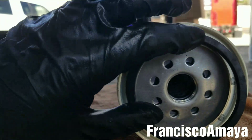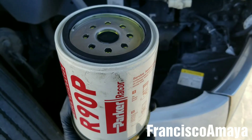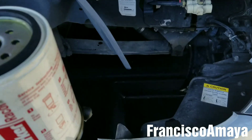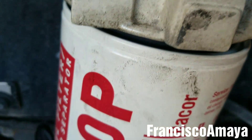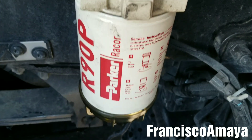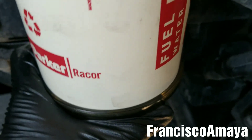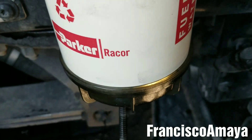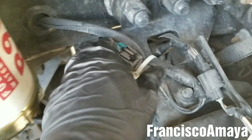Now we're going to install the fuel water separator gasket — this is the seal that goes on top. Pretty easy, you just place it here and that's it. Now we are going to fill the fuel water separator with clean fuel and then we can install the filter. Just make sure to align it with the base and rotate it — it's pretty easy, nothing complicated. Once the filter is in position, hand-tighten it. Don't tighten too much because then it's going to be hard to remove. Double-check the cap, re-tighten it if needed, and reconnect the plug. That's it for this part.